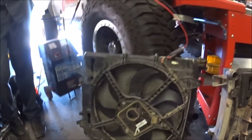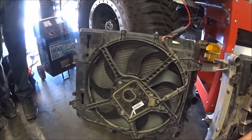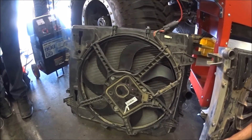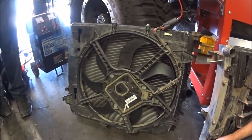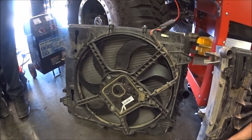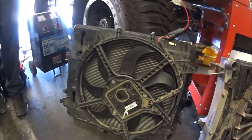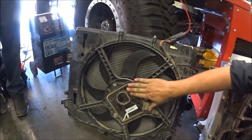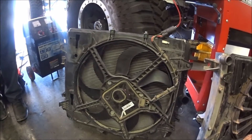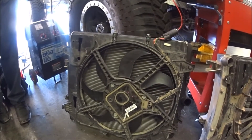On the other hand, the PentaStar fan is flatter, has a 19-inch fan blade, and one of the reasons the PentaStar fan moves air more efficiently is the large diameter of that blade, the larger opening in the shroud — as you can see, the majority of the core is open for airflow to go through and not blocked by the edges of the shroud. It is a brushless motor, electronically speed-controlled, ball-bearing, and sealed, so water's not going to get into it. This means it's going to run a long time. The outrunner design puts out inherently a lot of torque, so it can spin that 19-inch blade at low speed efficiently.